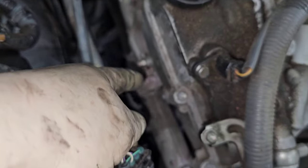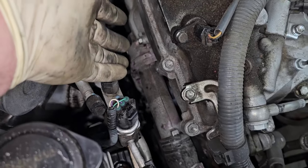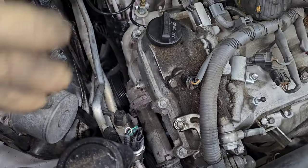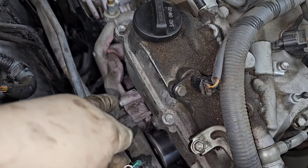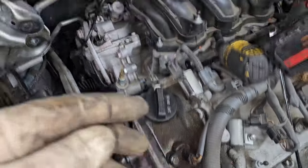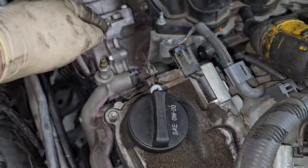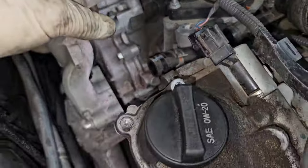The next step is we're going to have to take this water pipe out here because it sandwiches the water pump in between the block. I believe it's also a thermostat housing. I got the clamp out of the way — I can't stand Toyota clamps, I think they're terrible, but they hold. So now let's get the hose off and unbolt this to move it out of the way. There's two bolts and a nut — a bolt on top, bolt on bottom, and a stud. Once that's off, this thing will pop off the O-ring. Separate the hose from the end of this piece to get it out of your way. A little pressure — pop that off and this comes out.